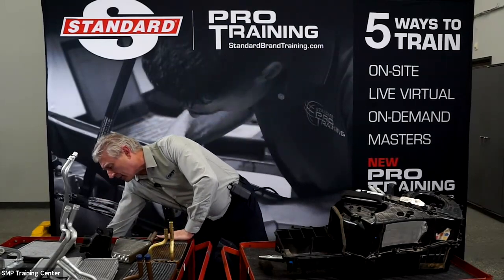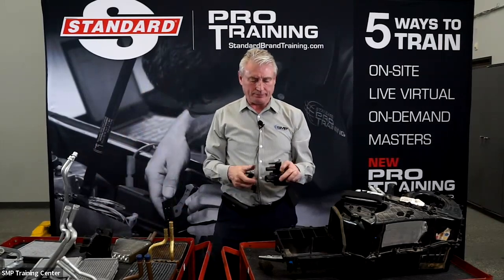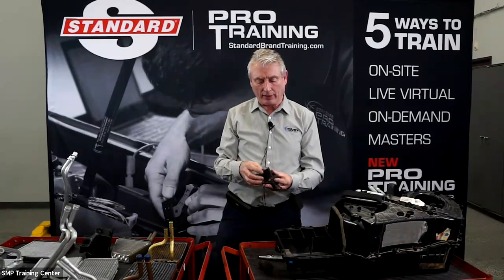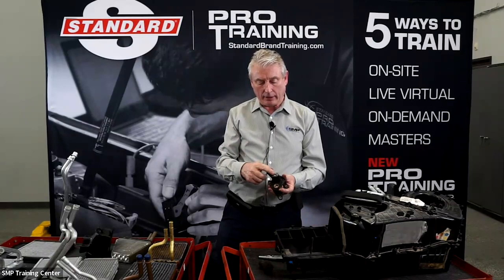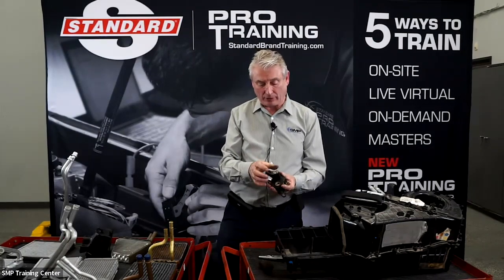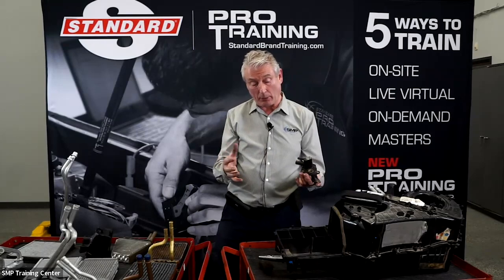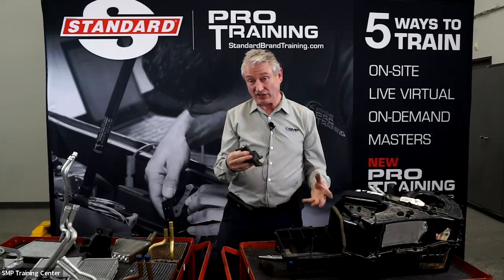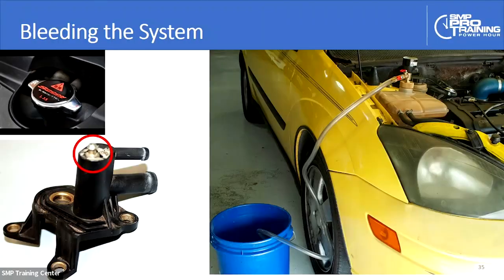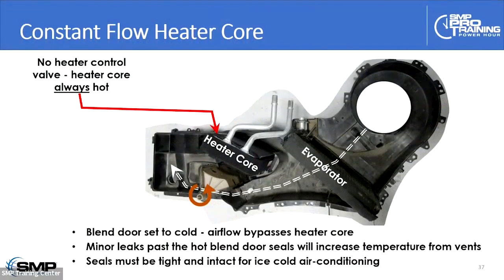Many vehicles today have a water outlet with a bleed screw on the outlet. How many times have you gone to one of these outlets trying to bleed it, and the bleed screw breaks off — or it breaks the plastic — because it's been heat-cycled tens of thousands of times? I'm mentioning this at the outset: as you discuss the repair with the customer, just be aware that these are some of the things you might have to replace as part of that heater core replacement process.